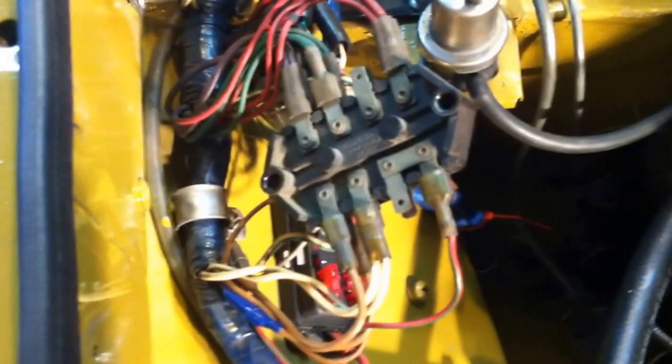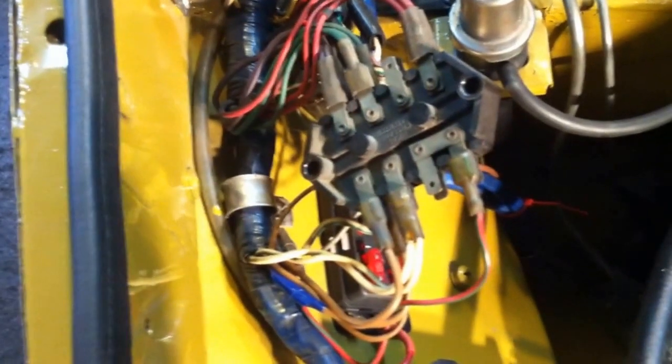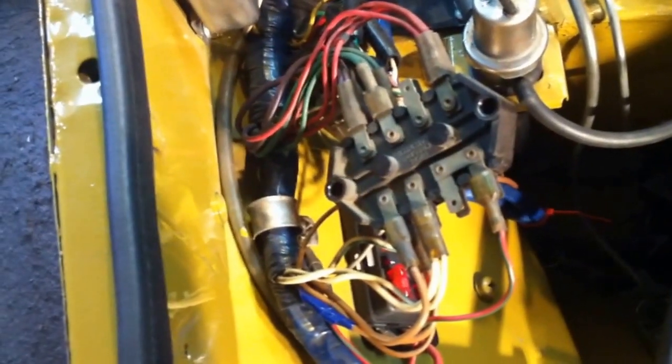And I've got a battery shut-off switch on this vehicle, so I've disconnected the battery because we've got some brown wires there, and as we all know, brown wires are direct to the battery, so unfused. So if you touch the ground or anything, you're going to have some sparks and possibly some burnt wires. So I'm going to clean that up.